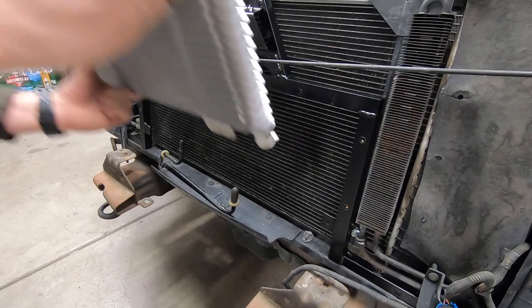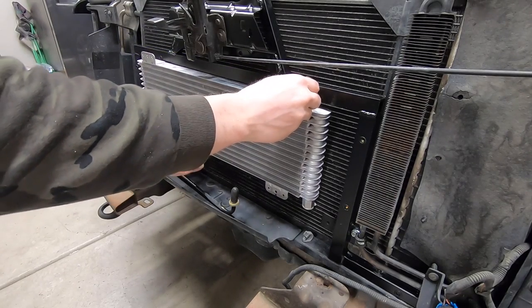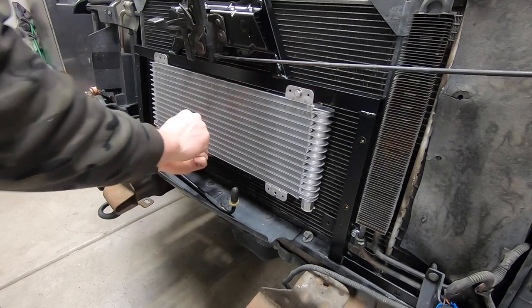I'm gonna take the radiator out of the loop, so it just goes straight from the trans to the TrueCool 40K. And then I think I'm gonna redo my supercharger heat exchanger, maybe do a thinner one that's taller. That way it'll let more airflow pass through and get to the trans cooler. So a few minor changes, rather. And it hasn't gotten hot to the point where I'm concerned about it. It's just gotten a little warmer than I would like.